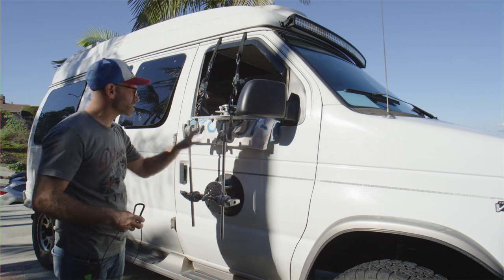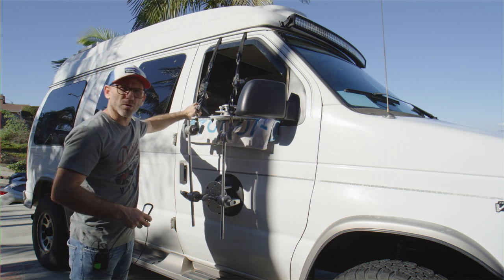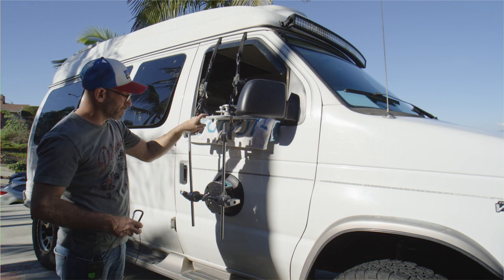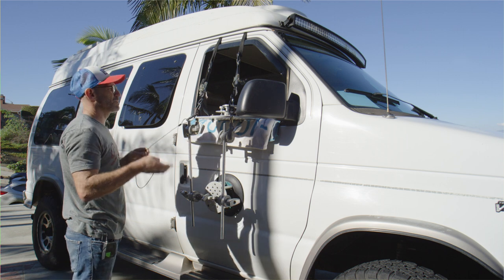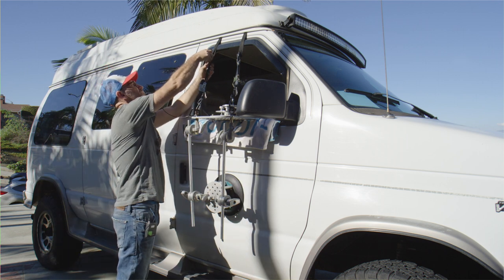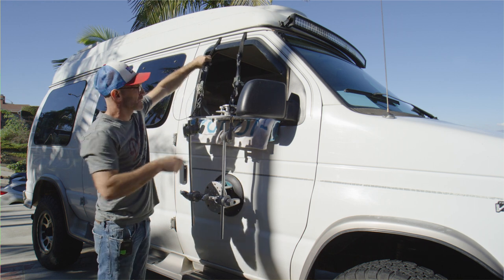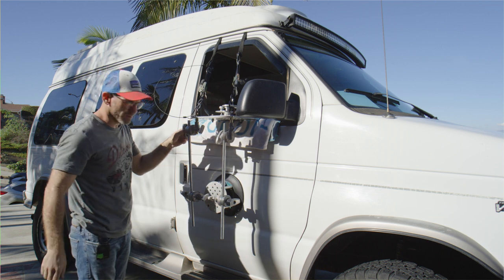Now it's important that the chain has to be connected to a hard part of the car or one of our safety straps here, but not from the plate to the suction cup. So for this rig, we're gonna clip it on the eye bolt here and to our upper strap, because this is a second separate section and this is secure. This can safety the whole rig, keeps it from coming loose, and we have carabiners on either end.